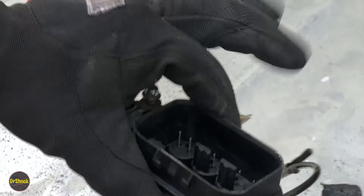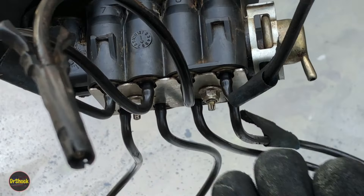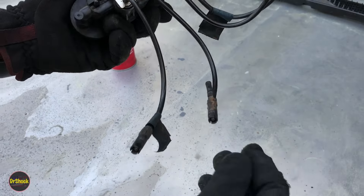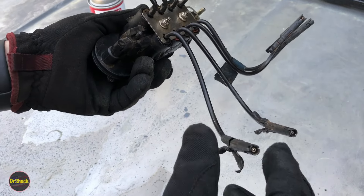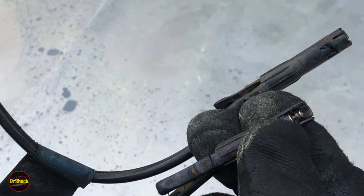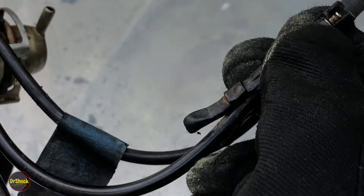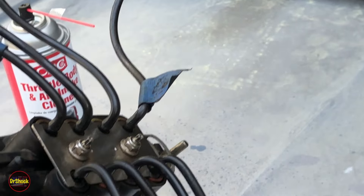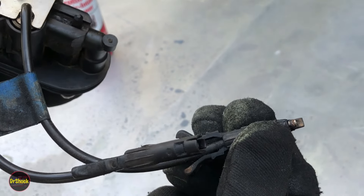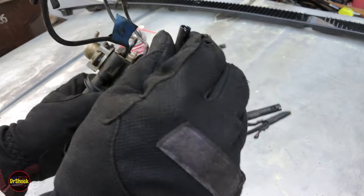We've got our fuel meter assembly cleaned off as best we can. Being electronics, we don't dip it in the parts washer — we do everything externally. As we inspect it, we see we're going to have to replace some of these injectors, so we'll end up replacing all of them. You can see we're missing pieces of the plastic right at the nozzle on the number four cylinder, missing some on number eight, and missing a retainer on number one cylinder.